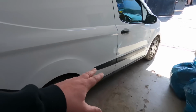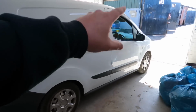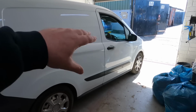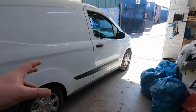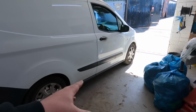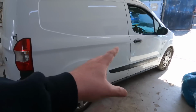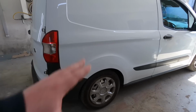And then I had the rest of the paint. So he took a separate reading there. And then I got him to go round the van and get all the rest of this sort of original, and it's the same colour both sides. So I had that made in 2K direct gloss. We do the mouldings, the trims and the bumpers in that colour, and then I've got the correct colour here to blow in and blend out and make that look right. Don't want to paint all them bits and it stands out really badly. So that's what's happening with that.